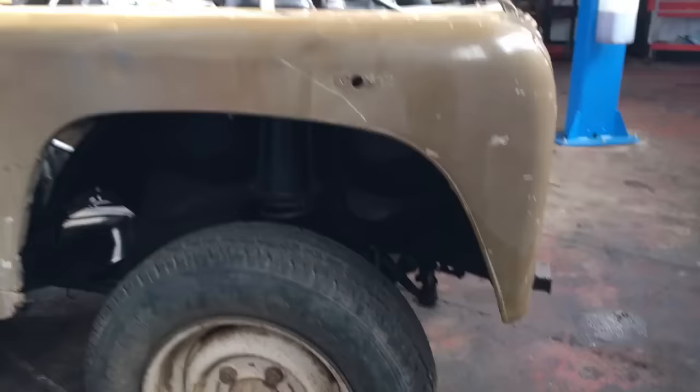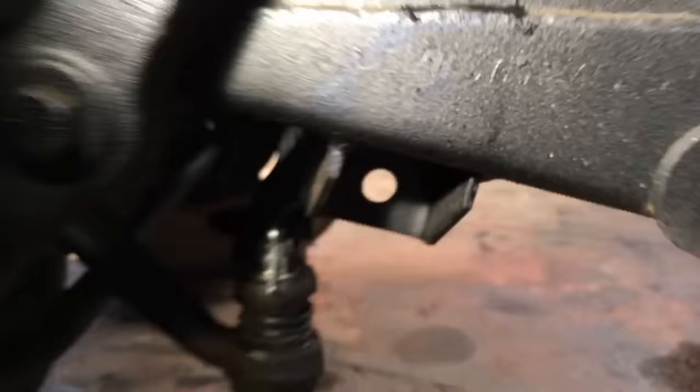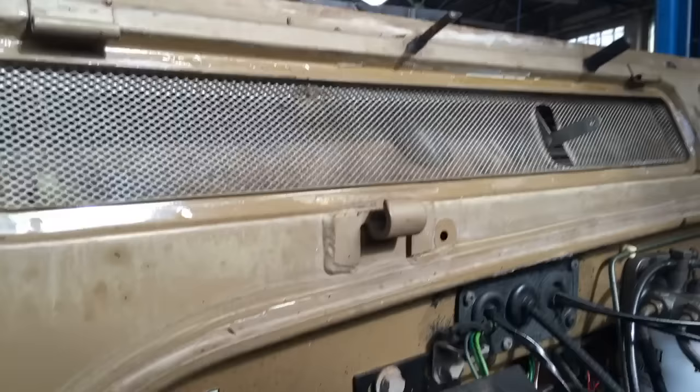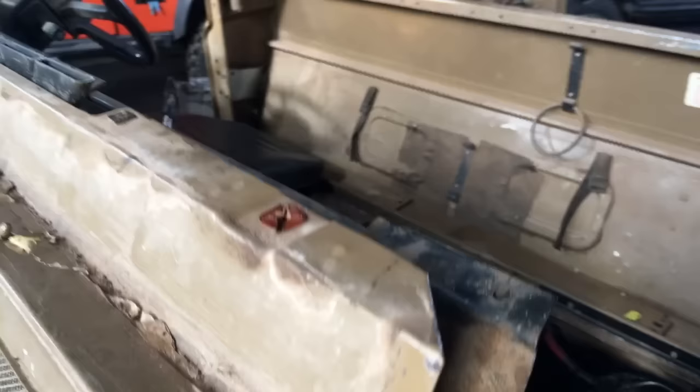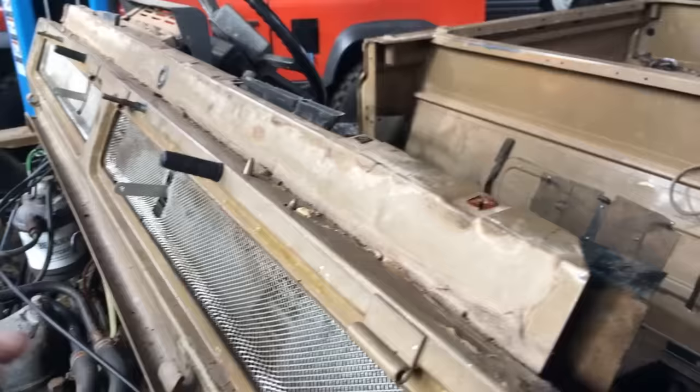Looking at the front of the vehicle, to check the chassis number you'll come in here and read it. If you take a picture with your phone and zoom in, you'll get a better view — it's much easier than trying to read it by eye. Make sure it corresponds with the one on the VIN plate. If you've got a 300 TDI or later, there'll also be a little plate riveted just in the windscreen area. If it's come off, don't worry, because that does happen when windscreens get replaced and they go brittle. Just make sure the other two numbers match.